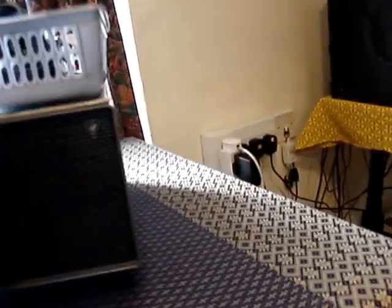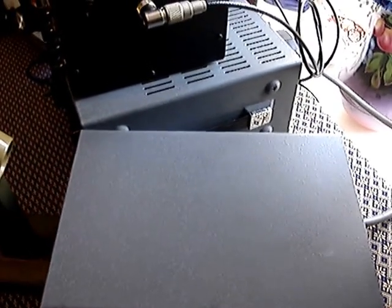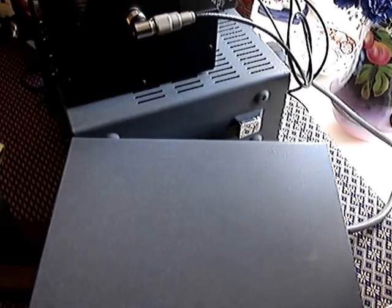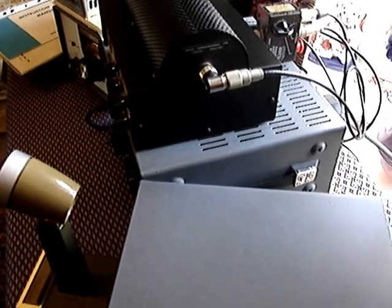Going around the back to look at the cabinet — it's covered in a sort of metal-textured paint that looks all lumpy. It wasn't really primed very well, being a budget radio, so they are prone to rust coming through. The reason is they were sprayed with water to help the paint key, and because primer wasn't used, if you keep it in a warm, damp place the rust comes through the paint.